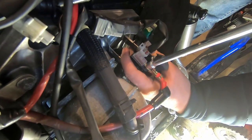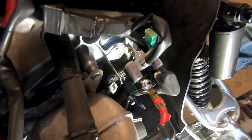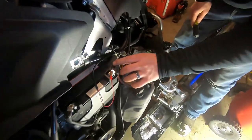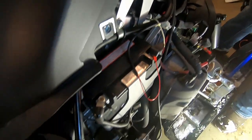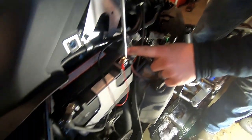It's going to slide right off the side there, and then it's just an 8mm to undo those two nuts. Then you'll unplug that top one and then you'll be able to re-bolt everything back in — real quick easy fix. Undo your battery first. Yeah, always undo your battery first before you start messing with electrical.